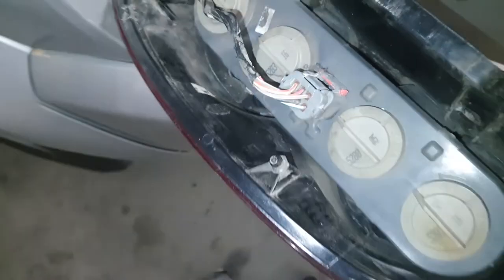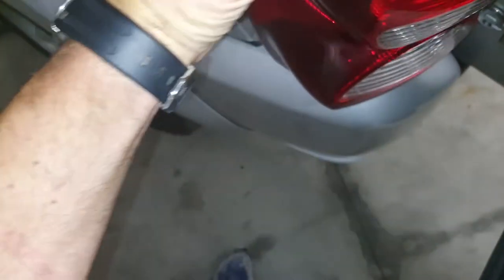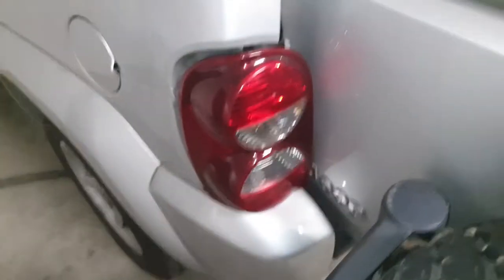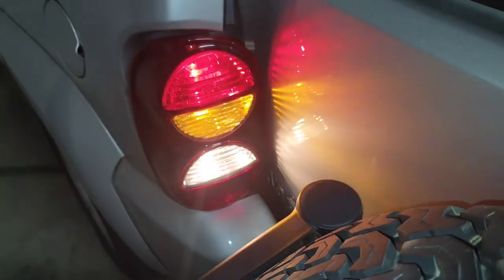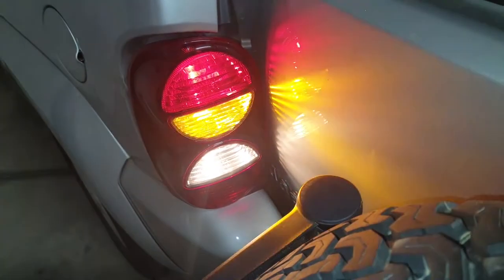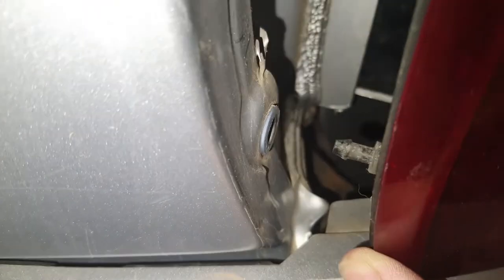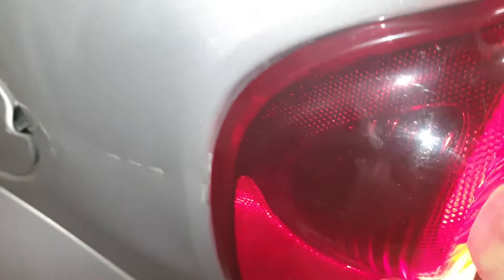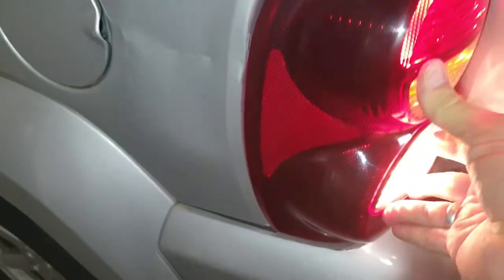To reinstall: reinsert the little grommet in the hole at the bottom, push the plug in, put the lock back in place, and line it up. Do a light test check just before you fully secure it. All looking good — I'm sure the brake light works, I'll do another check with a mirror later. To re-secure, literally just push it in, line up your rubber grommets — one down the bottom and one at the top — and push it back in place.